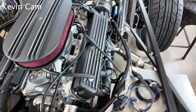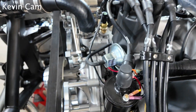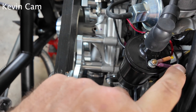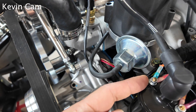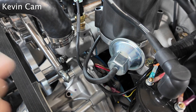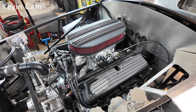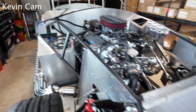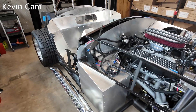Taking a quick look at the coil: the black wire here is actually the yellow wire that came over, and the orange wire is on the positive side of the coil. All of the major wires are now connected. We just need to hook up the little programmable computer and connect the radiator fan wire, and then we're good to go.